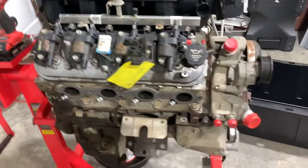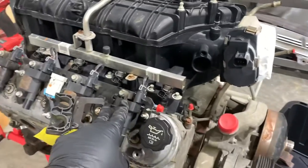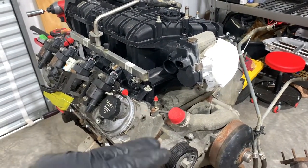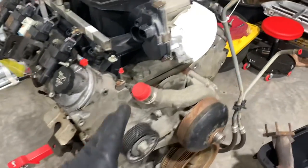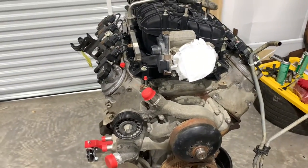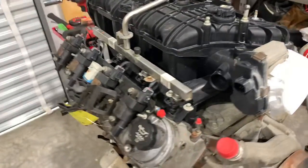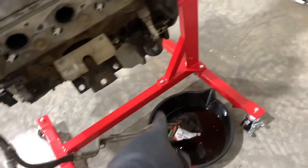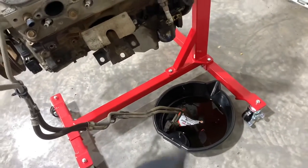The plan is to strip it down. We're going to wind up doing an intake, clean the block and paint it, do some valve covers, a new accessory drive, and just some basic going-through to get it ready to pop into this truck. I've already done a couple things — we've got the exhaust manifolds off. That was the thing I was most nervous about because those bolts tend to freeze up and rust inside the bolt holes. I was fortunate — they came right off easy. We've also unbolted the oil cooler lines and we're letting that drain out into the pan. Let's start breaking the rest of it down together.